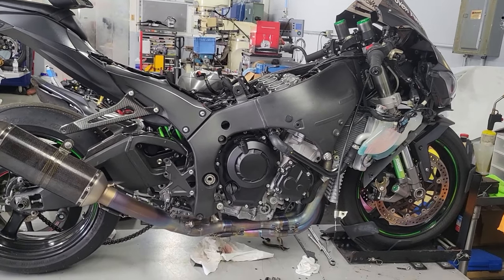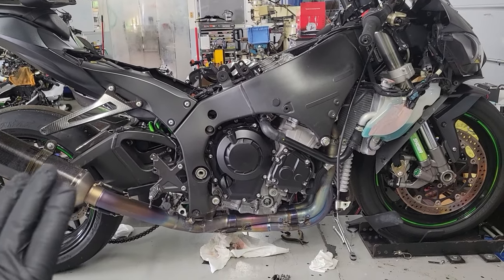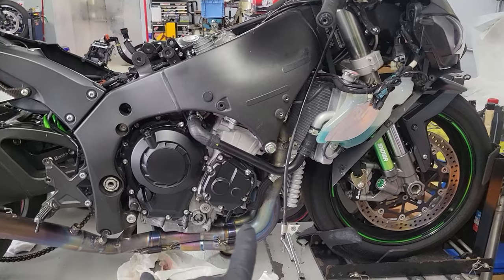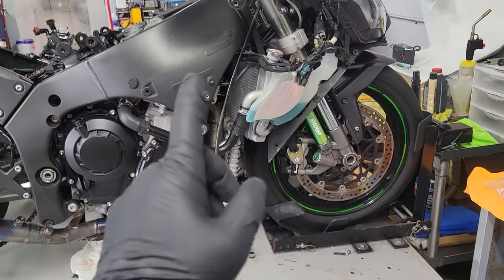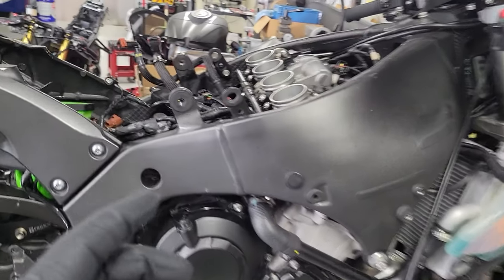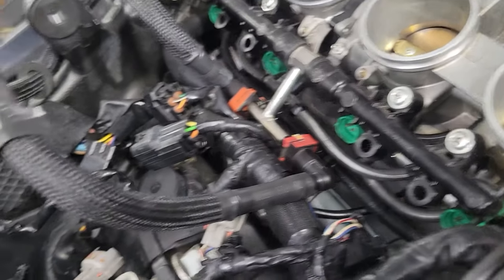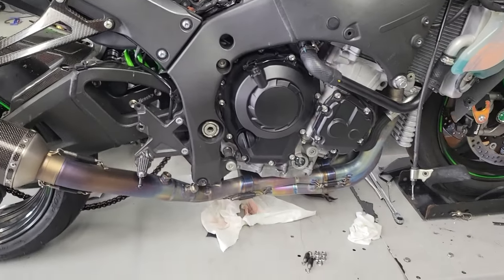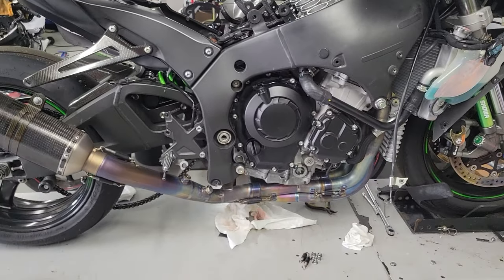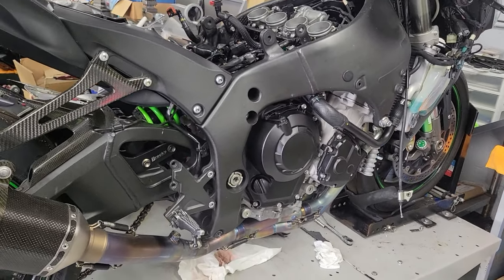Also, the head and cam project is officially underway on the ZX-10 motors. The motor is almost ready to be pulled — the exhaust is hanging on by about two bolts. Once we undo that, we take the exhaust out, remove the radiator, the oil is drained, the coolant is drained. All the wiring is pretty much undone — just a couple of grounds and a few hard-to-reach plugs like the ECT left to unplug. My goal is this week to have the majority of this done. I'm getting very excited. I usually do stupid stuff whenever I pull the motors out, but we'll see.